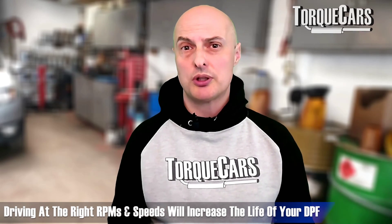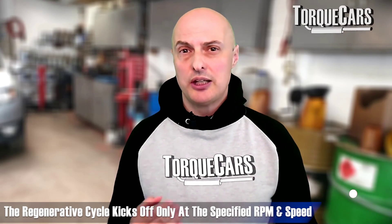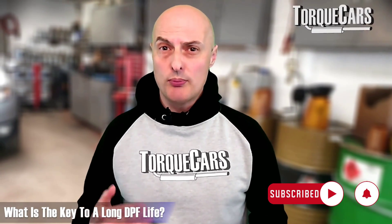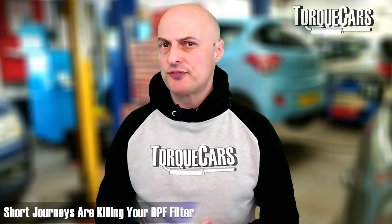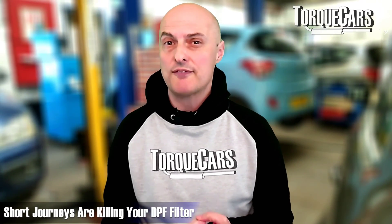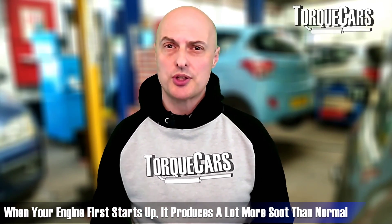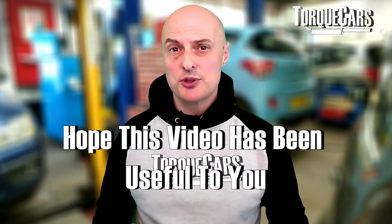Please read your manufacturer's instructions for how many RPMs you should be driving and at what speed, because it's critical to do that correctly for your engine's design in order for that regeneration cycle to kick off. The key to a long DPF life is to make sure the engine is operating at warmer temperatures, not producing great amounts of soot, and the DPF itself is getting time to burn off the soot it has collected. Avoid driving the engine while it's cold - those five and ten minute journeys are really killing that DPF filter. When your engine first starts up it's not very efficient and will produce a lot more soot than normal.